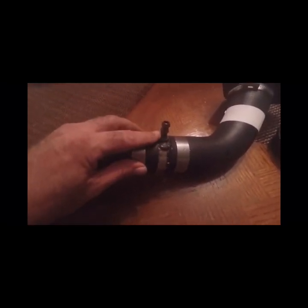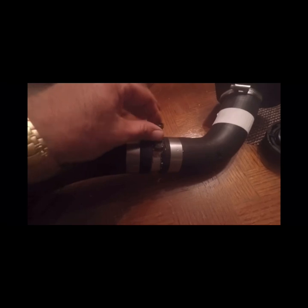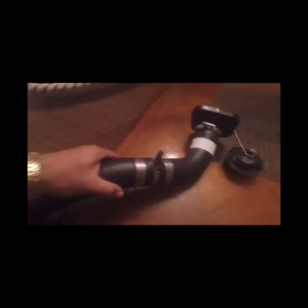I put my mender in. I made sure I marked the hose so I could get exact alignment, so that when I went back, it would go back exactly how the hose came out. I had to cut out just enough — with that barb — the width of that barb of the hose. Right here, I glued in the tie-strap holders up on the inside of the hull, so that once I ran my hoses, I could tie them back, get them out of the way, and keep them off the motor.